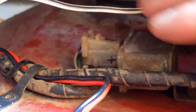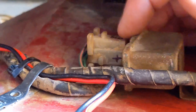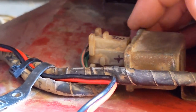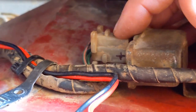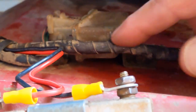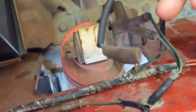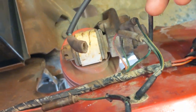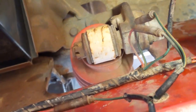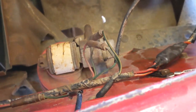Here's the horn relay we were just talking about. The wires come in from under the dashboard — there's 12 volts coming into this relay. One direction goes out to the switch which activates the relay, and the other wire, when you activate the relay, gets electricity and comes here, connecting to this wire right here.